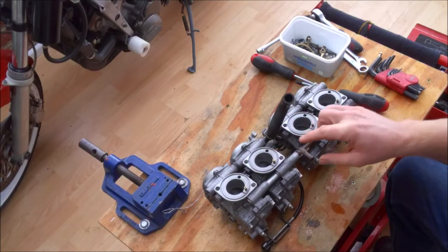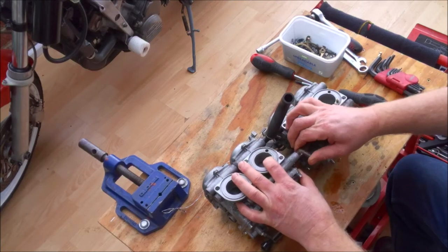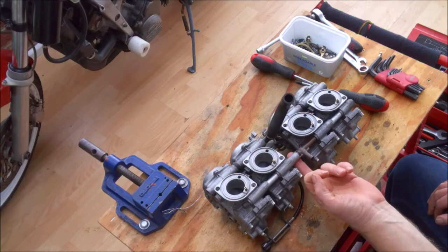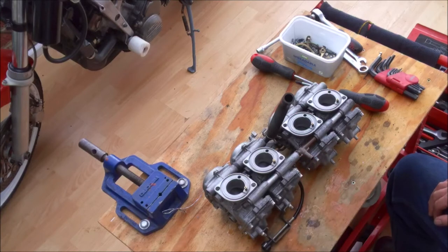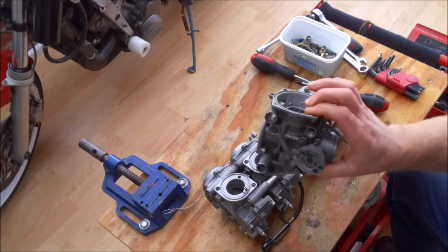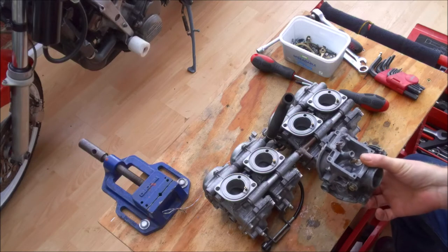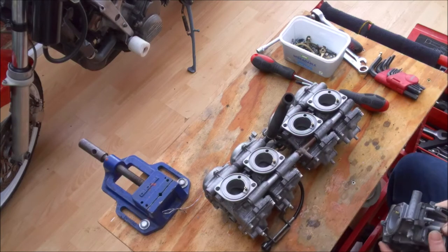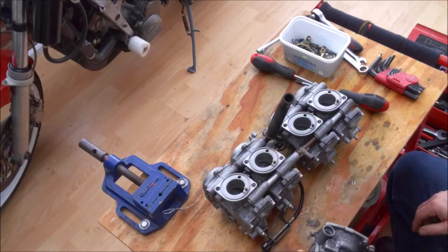I took the carbs apart, pulled the T-piece out, cleaned up in there, put another o-ring on - and it's still leaking. There is definitely too much wiggle room there, you can see it doesn't feel that tight. The only thing I can assume is the carb body itself has corroded and worn away and we're not getting a good seal. Fortunately I've got another set of carbs and another number two carb body, so I've given that a quick run through the ultrasonic cleaner, blasted everything out with compressed air and carb cleaner. So for the god-knows-how-many-th time we're going to dismantle the carbs and swap this carb body over.